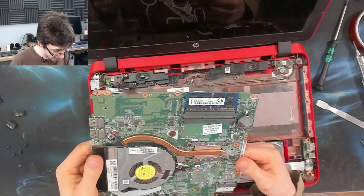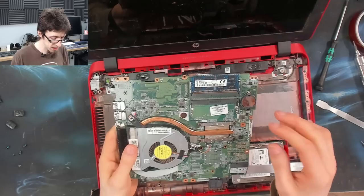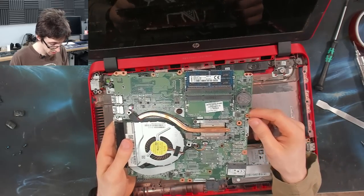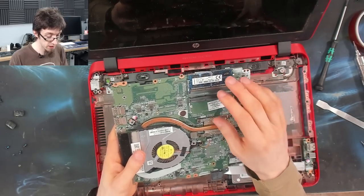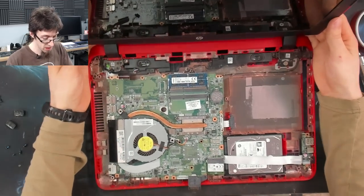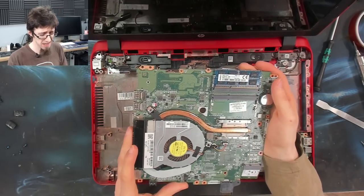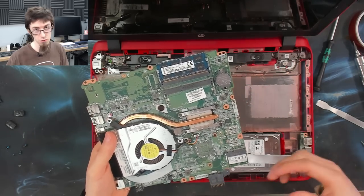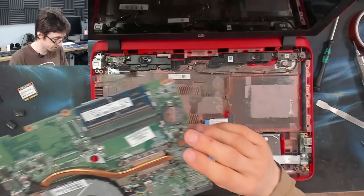And our survey says 8 gigs of RAM, yeah. Single module. I might see if I've got 2 4s and break that down into 2 4s. Because that will give it dual channel memory. And also it means that I've got another 8 gig module lying around. So that's a win-win for me. The laptop gets a better memory config because this thing's never gonna see 16 gigs of RAM. And it means that I've got another 8 gig module, so I can put 16 into another laptop that would benefit from 16 gigs of RAM. Good.